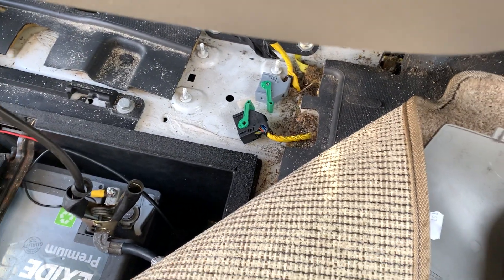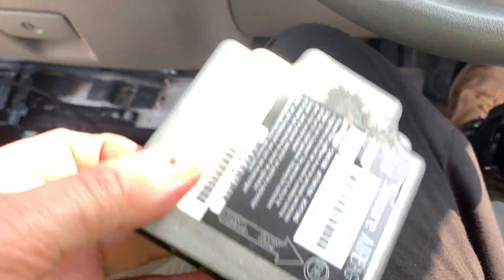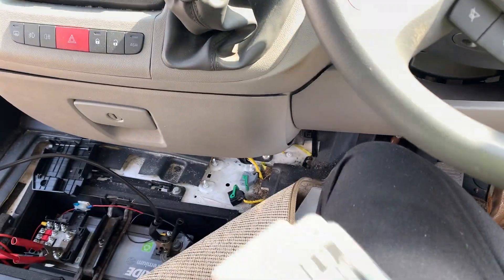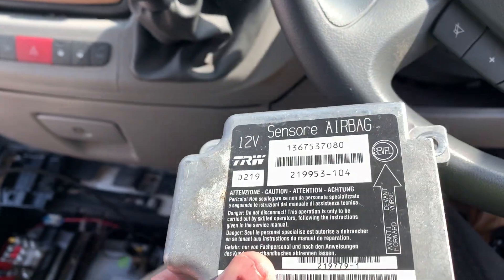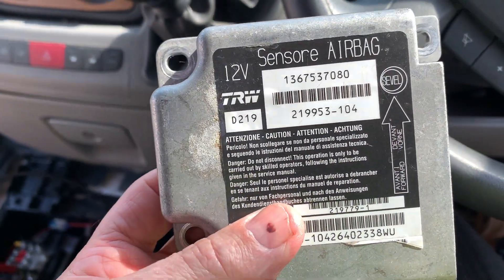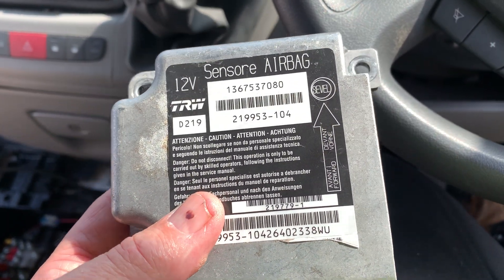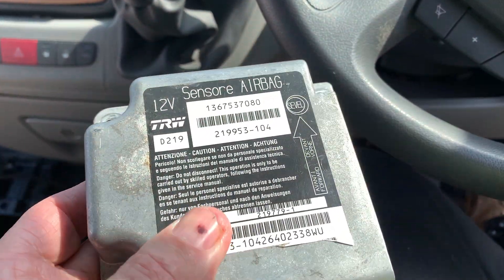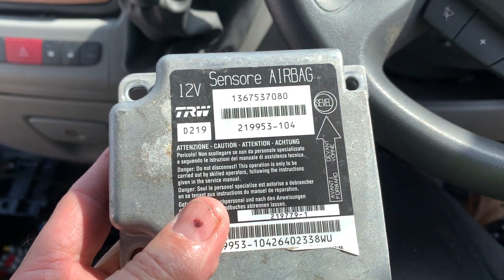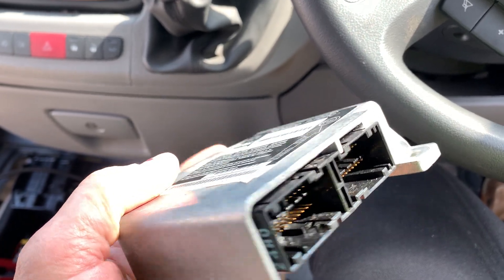That is because the airbag has in fact been removed. The reason it was removed is because the airbag module reported an internal fault — a B1001 internal fault. So it was sent off, they sent it back and said it's all been repaired, we plugged it all back in and it still failed with an internal fault. So it was sent back again, and hopefully this time they'll have actually done the job. If it hasn't been repaired then this unit is in fact faulty and not repairable.